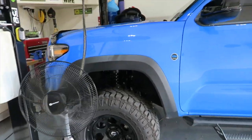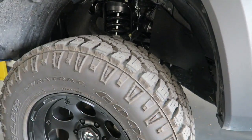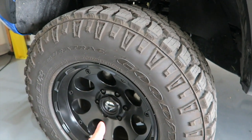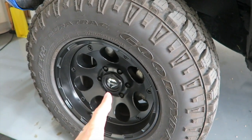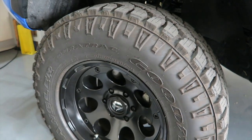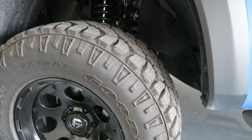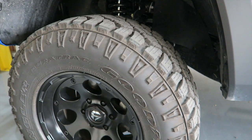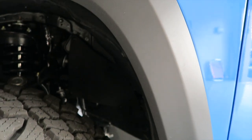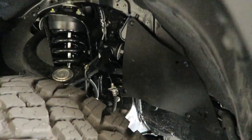In the front is where it gets more interesting, because the front is what you need to be concerned with if you're going to do anything with bigger wheels and tires. I went with a 17-inch wheel — down from the 20-inch I had before, which was way overkill — and a 285-70R17 tire. I think it's the perfect look and perfect fit for the Tacoma. I do have a negative offset on my wheels, which gives me a little bit of poke, and I love the look.